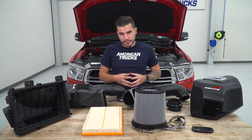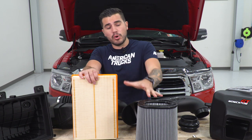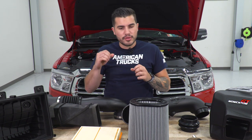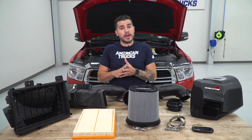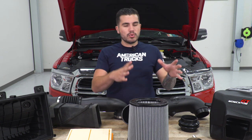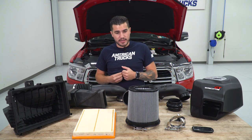Let's start with the main player — the filter. I took apart the factory airbox to expose the flat drop-in paper element dry filter. The only real similarity is that they are both dry filters. The AFE unit is a nine-inch tall conical 360-degree radius filter with an open top, made from three layers of synthetic filter media that gets progressively finer throughout each layer. That means it does a much better job filtering out unwanted particles. The factory filter is just not optimized for airflow and filtration. AFE lets us know this whole kit has been computer designed and dyno tested, proving up to a 39% increase in airflow over your factory kit.